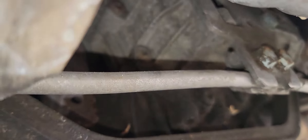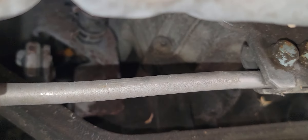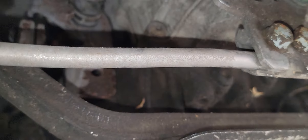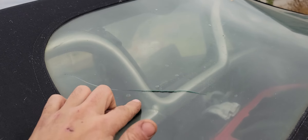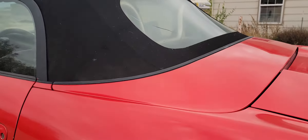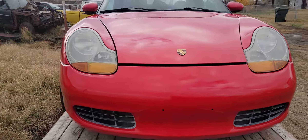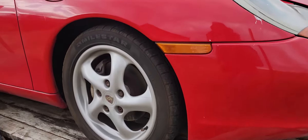Found a problem. It is this coolant hose down here, this guy right there, where that one hooks up to and that one hooks up to. It's called a heater control bypass. There it is, it's up there, behind that. And that is what is leaking.